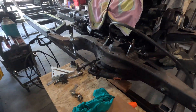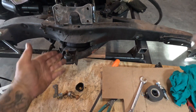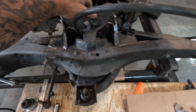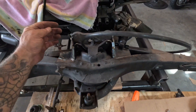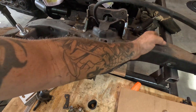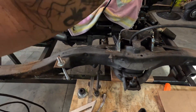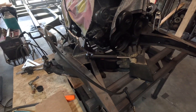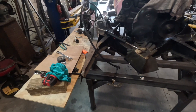Currently we're working on the passenger side. My round grinding stone finally came — that thing looks beautiful, almost looks like it was machined. This part is going to sit inside here, it's going to get bolted on. It's very important that it maintains the same shape for the control arm. Once this is bolted on, we're going to weld all this up. We've got gussets in here — really nice, make it strong. The shock mount is obviously going to go here. Once all this is done, I'm going to pull the engine out, sit it on the floor, flip the frame upside down, and then there's some other stuff to weld once I get to that destination. One thing at a time, one day at a time — always trying to stay busy, always trying to make progress.